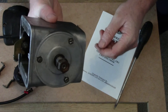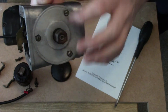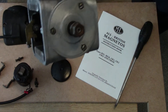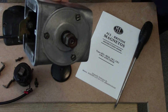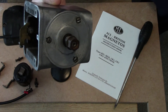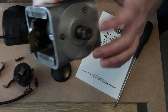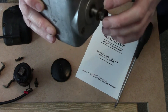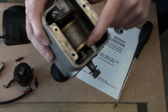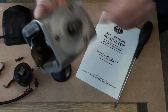To get the rotor out, there are three screws here. On this magneto these were really hard to get out — I had to use an impact driver to shift them because they were very tight and obviously hadn't been out for years. Once those three are out, the cover can be removed and exposes the rotor. There are bearings inside — a set at each end.